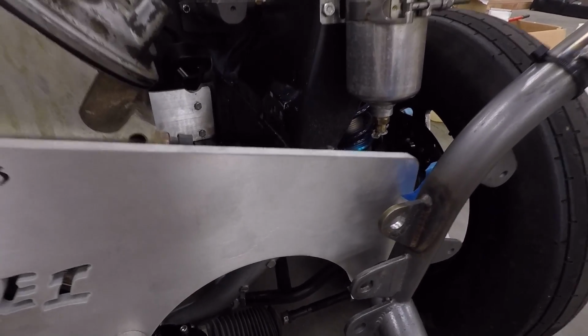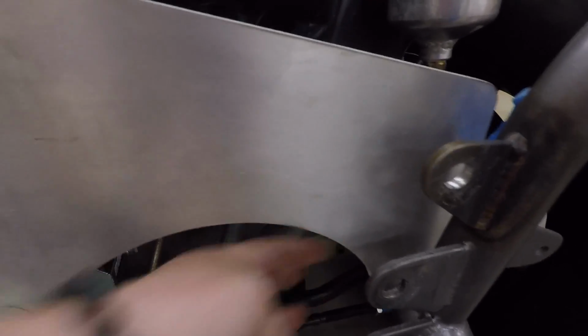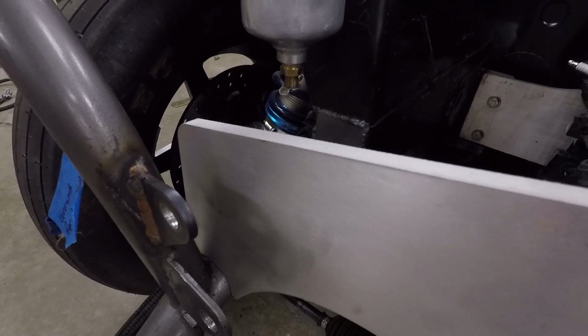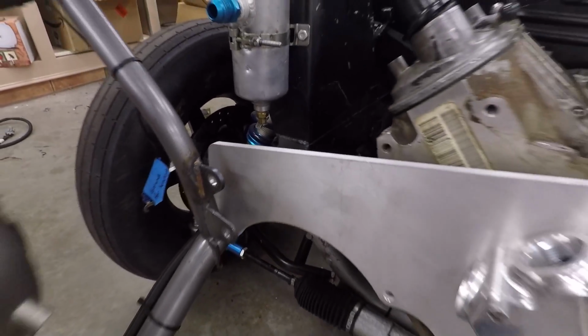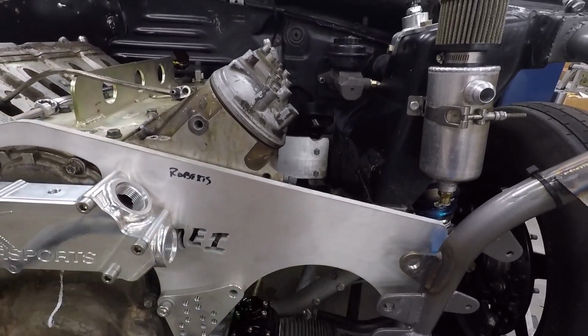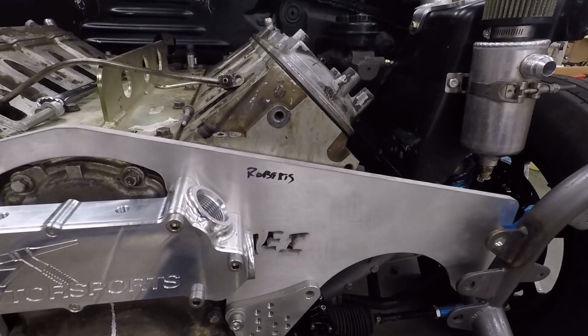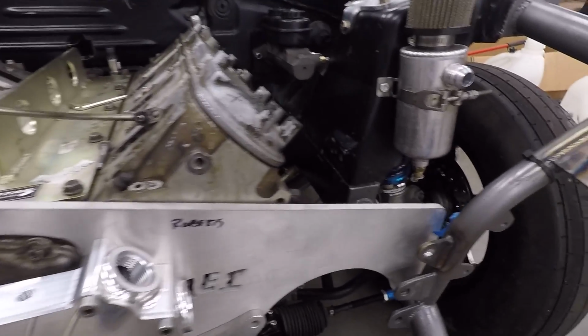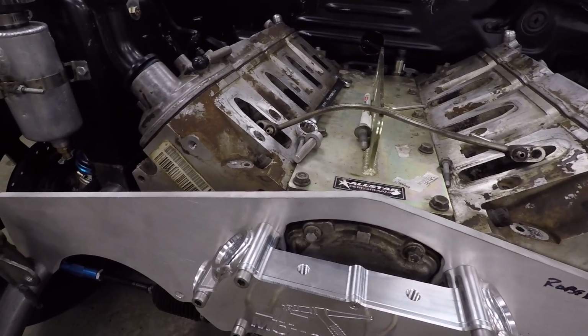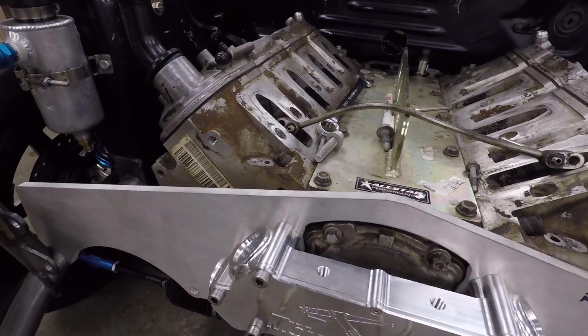Got some things to modify a little bit. You know, the motor plate right there where it's sitting on the bars, it's not going to just sit on the bars like this. There are some tabs that'll be welded on, and then it'll weld on behind here, and then it'll be similar to these, and it'll bolt right in there. So it'll sit on the bars, and then it'll also bolt up, so that should work well. But anyways, that's it for now until I can get some tools. So I'll see you guys soon.